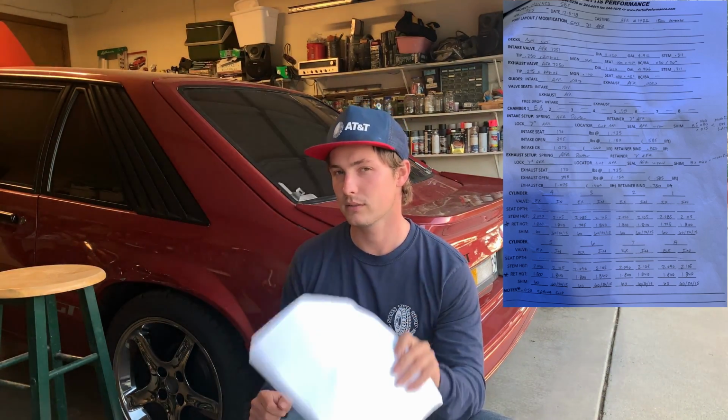Alright, I have AFR 185s, and I know I probably should have gone with like a 205, but it's going to be NA for like 3-4 months, and I wanted to be able to drive it NA, so the 185s just appealed to me a little bit more, and it's really hard to outflow an AFR head. And with 700, I think I'll get really quick spool up with the smaller head, so that's why I went with it. I don't know if it's right, I don't know if it's wrong, but that was my reasoning.